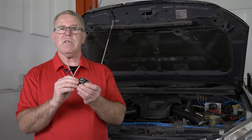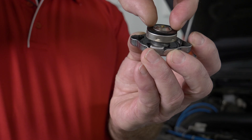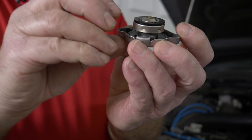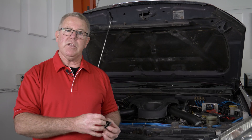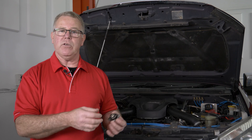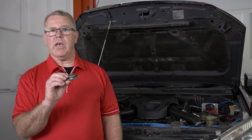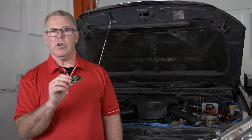As the cooling system cools down, the volume of coolant is going to contract, so there's an anti-vacuum valve there. It's going to contract, so we need to let more coolant come back in to take its place, or air, depending on the type of system. I've only ever seen two of those play up in my entire career, so it's not very common.